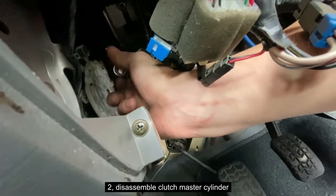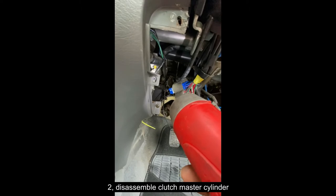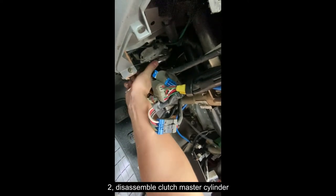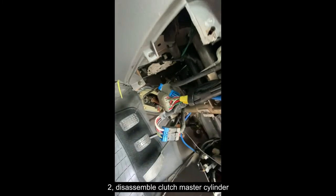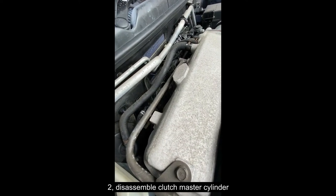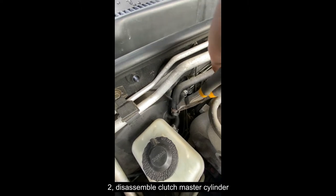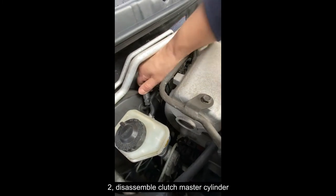Screw it all the way down. This is the opening bolt inside there — 12mm deep socket with an extension. You can just crack it, just like that. There's a nut, and another one in the engine bay. You can use a socket or spanner, whichever you like. In this case, I will have to disconnect the vacuum hose to allow more clearance.